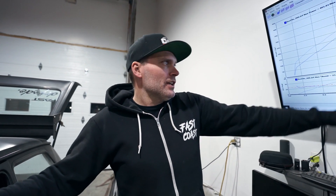400 horsepower club! Welcome! I did one last run in fourth and it did 401 SAE corrected with the ethanol in it. That was at like 22 pounds, which is a little bit more in fourth gear because of the extra load on it. But if I had to say realistically, probably 80 wheel horsepower more than 91 octane at very similar boost. About 80 wheel horsepower difference just by putting ethanol in the car and being able to advance the timing a bunch.